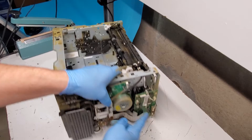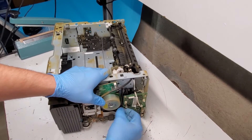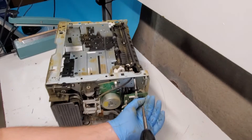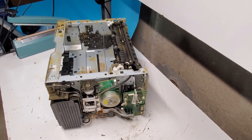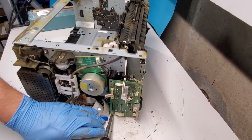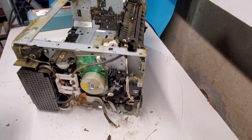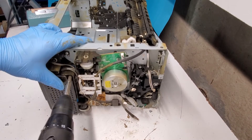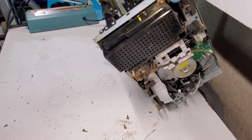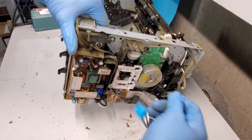Now we have the formatter board, or the main board over here. I'm just going to disconnect this from it. This is the drive motor right here. I'm going to remove the printer main board and gently pull it out. Now this is the power board. I'm going to remove the cover first — there are two screws that hold the cover — and we need to remove this cover in order to let go of this fuser cord that goes there.